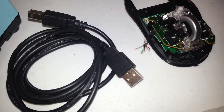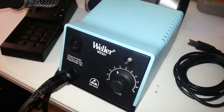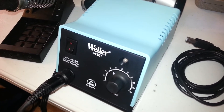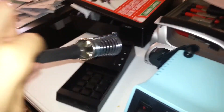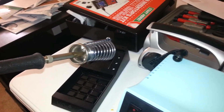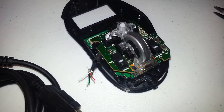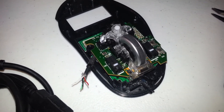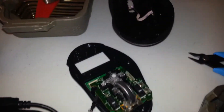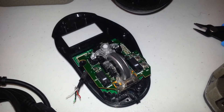You do the same thing — get those four wires out and splice them with a soldering iron. I've got this pretty standard Weller with temperature settings and a soldering iron tip. Use that to bridge them together with lots of solder, and maybe cover it with heat shrink wrap when done. Though I can't imagine spliced wires being any stronger than the original wire that broke.